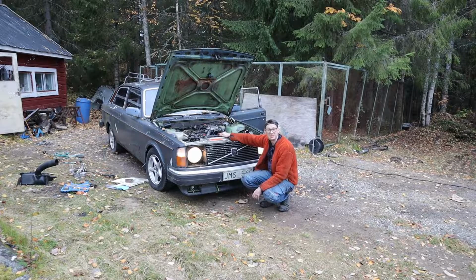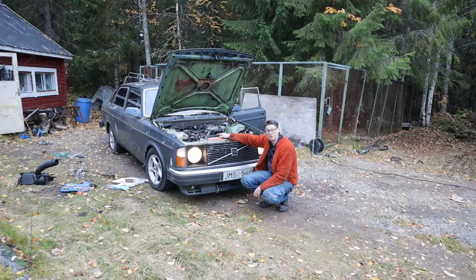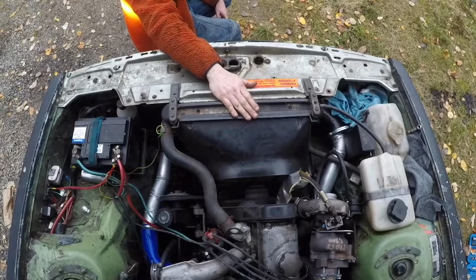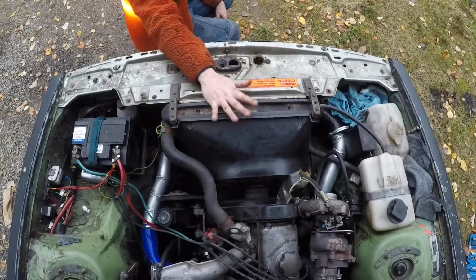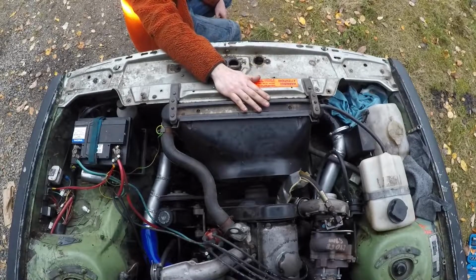What we can learn from all this is I should stick to diesels, because as you can see, I have a problem. Now it runs good and everything, but it doesn't run on the high RPM, just like the first test run we had. It sounds mean and everything, but if I get it up to like 3000 RPM, it breaks up. That's worse than it was before the turbo. But it did break up before I did all this work, and I thought it was on the good side for turboing, so I didn't make any more effort figuring that one out.